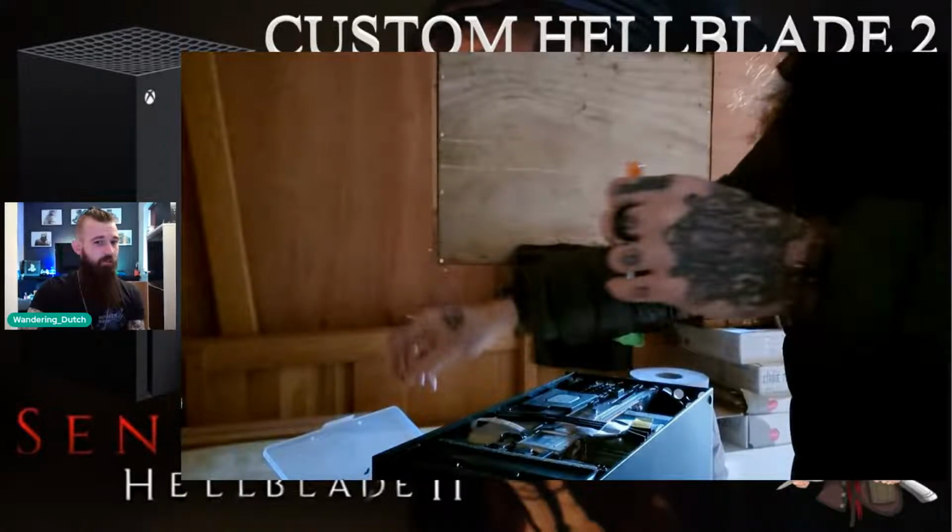And there's another, which is down by that square gap on the right-hand side of the console, that is connected to the USB drive. That also needs removed. You unscrew the stand on the bottom of the console. That gives you access to 3 screws that hold in the entire midsection of the console, which includes the CPU, the GPU, the joint motherboards, the heatsink, and the PSU, the power supply unit.